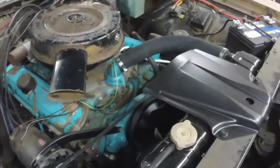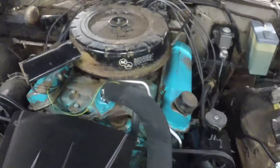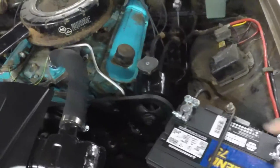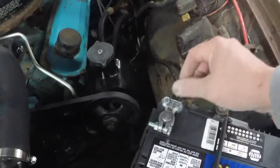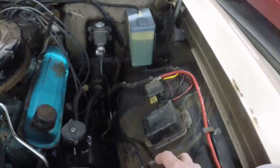I like to rebuild my own alternators and generators. You can check your alternator by looking for a current drain — take your battery cable off and put a wire with a light between the cable and the post. If the light stays on, you've got something draining.